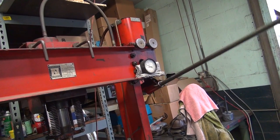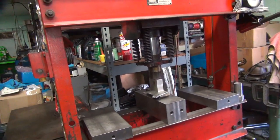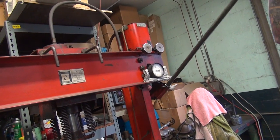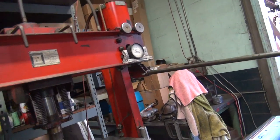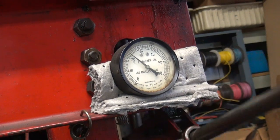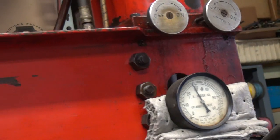See a hydraulic leak there? Maybe you need some new seals. Okay, is that thing flattened out yet? I think it's pretty flat. Where's all that oil going? It leaks a lot more than it used to. I think we need a hydraulic rebuild kit. Let me see that again. Yeah, you can't even get above 2 tons right now. That's 20 tons, 25. Look at that. I'm thinking there's an internal leak someplace. Probably.